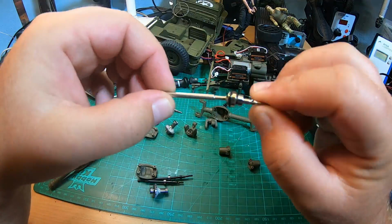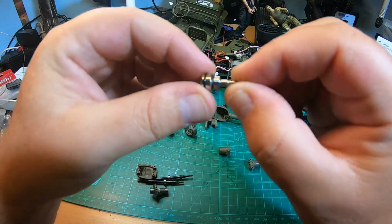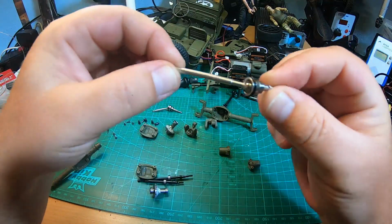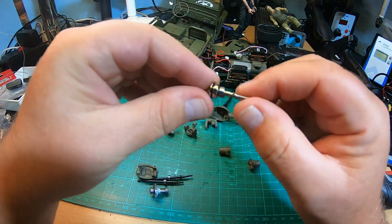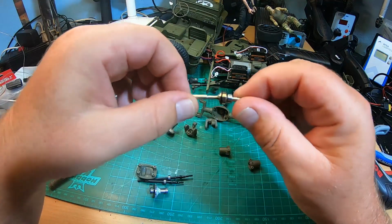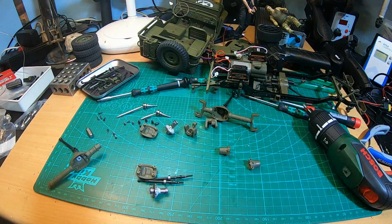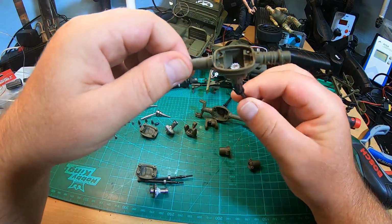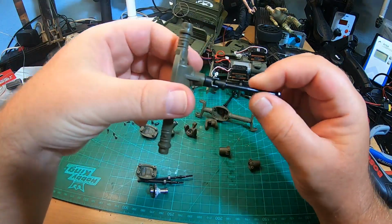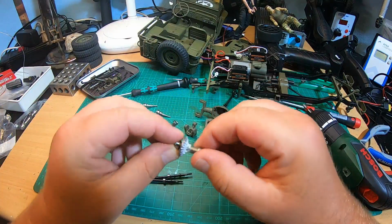And super nice universal steering. Some O-rings here to keep the pins in. Ball bearings. Wow, wow, wow, wow. So that's really a different quality than the cheaper 1 to 18th and 1 to 24th trucks do have. That's at least one step above. So, wow. Full metal drive shaft, full ball bearings, nicely greased,